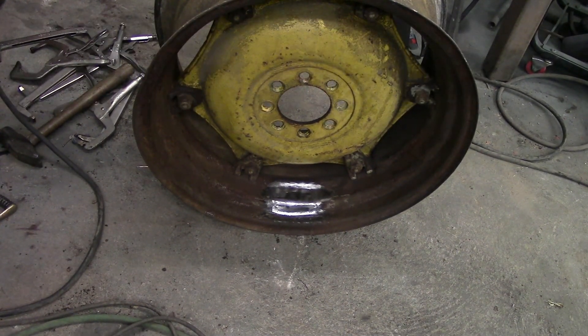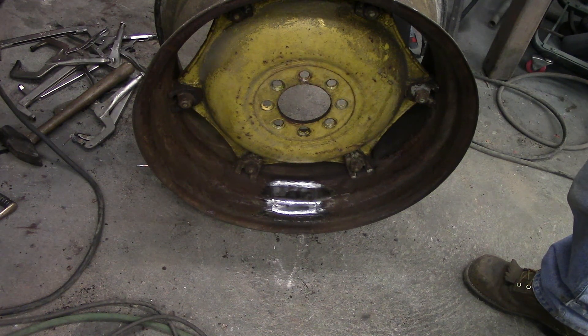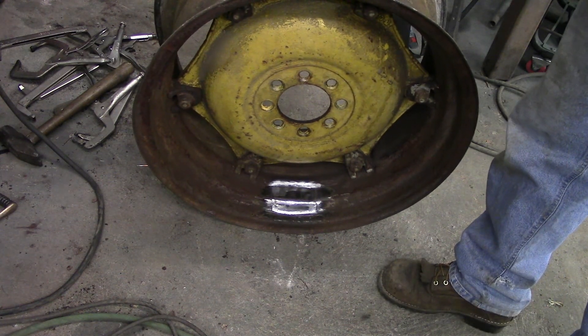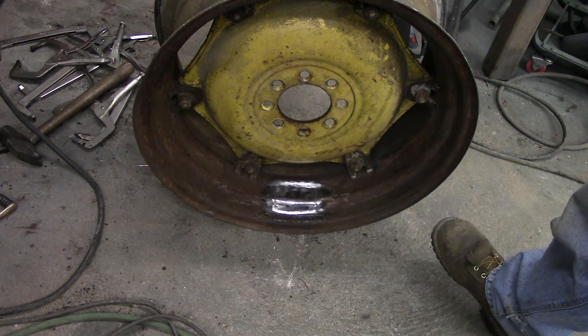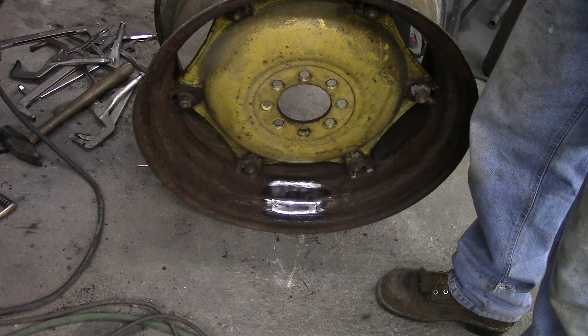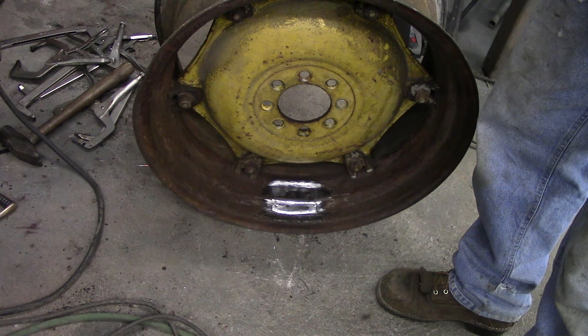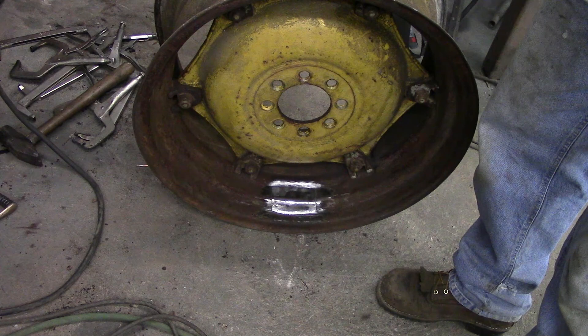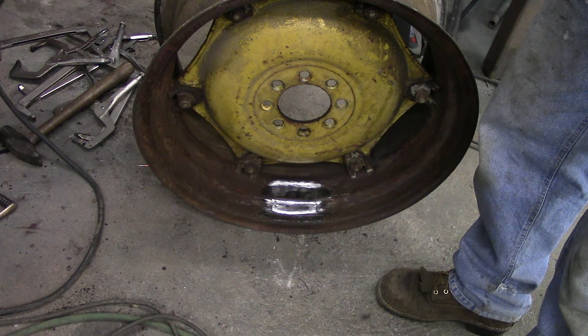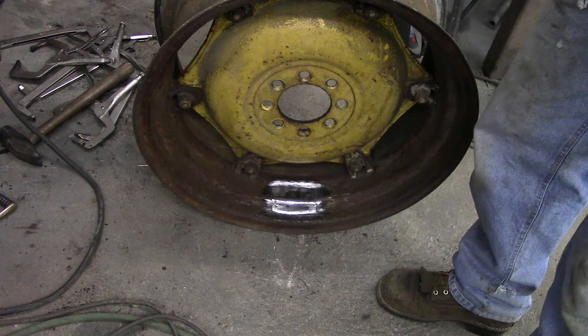This is my neighbor's wheel so I'm not going to drill the valve stem hole — he was going to take care of that. Something I did recommend: places like Fleet Farm sell non-fiber roof cement, which is basically tar, and you can thin that with kerosene or diesel fuel. If you thin it out and paint it on the inside of the wheel and leave it for a week or two, it'll clean it up and look just like new inside — it'll give it a black paint finish. That oil in the tar will protect the wheel and stop it from rusting, extending the life of the wheel quite a bit. Back in the 60s and 70s that's all they used for undercoating on cars — tar and oil — so it works really well. That's the end of this video, I hope you enjoyed it and I hope it helps you out. Thank you, bye.